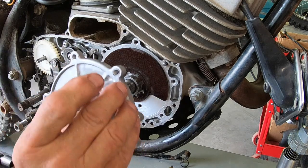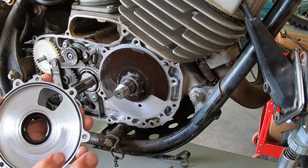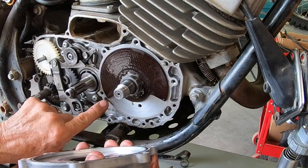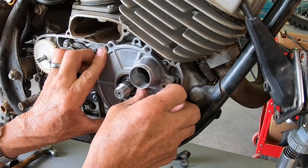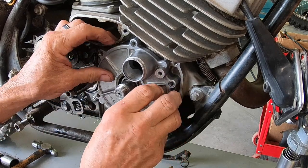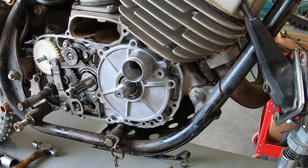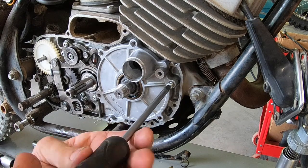But I just want to see if I'm going to need to find anything else just to get this thing running again. I'm putting a little lube on the O-ring, and that feels like it's okay too because it's sticking up above. Okay, we've got our 2 pins here, and we've got to try to get our seal started. There, I think it is. There. Everything appears to be down. And looks like the lip's good on our sealing surface there.